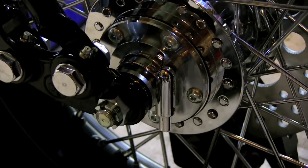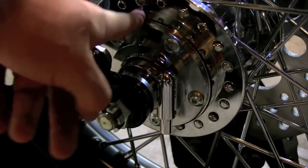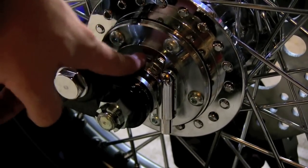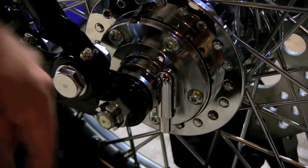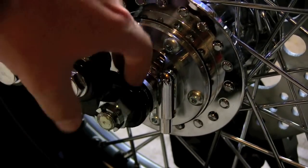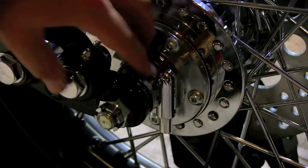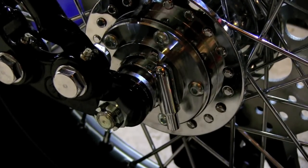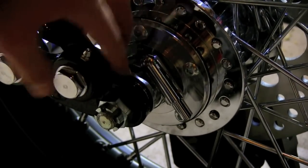One of the areas I've had the most amount of trouble with has been the front axle fitting. We've got this custom hub here for a speedometer drive. I've been through two different speedometer drives now that are both wrong. I torqued this one last weekend with a buddy and it just crushed it - it's the wrong spacing behind it. I'm just going to measure the distance and put a full-size spacer in there and be done with it. I don't really have any intentions of running a speedometer on this bike, so I've gotta remove all that, get a nice measurement, and get a spacer made.